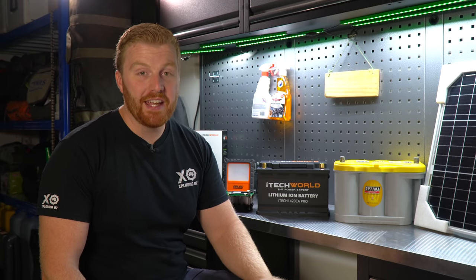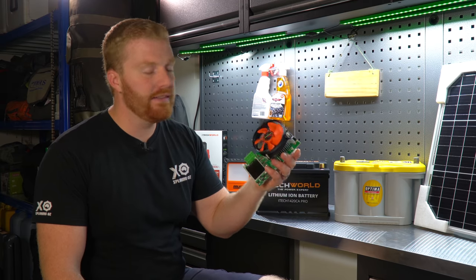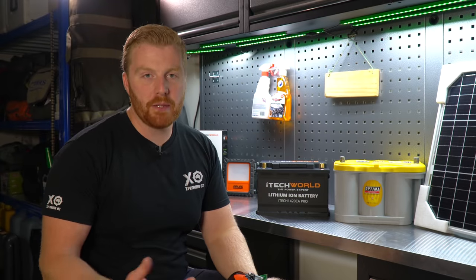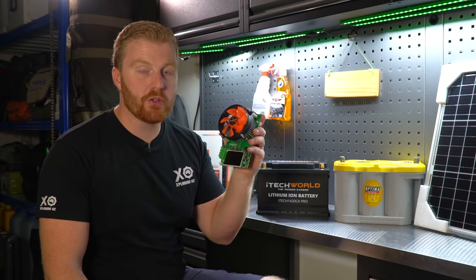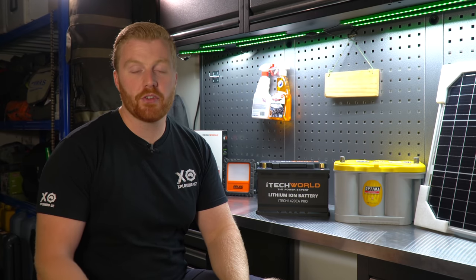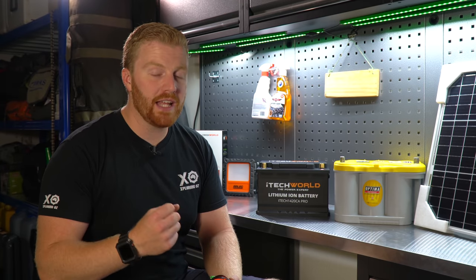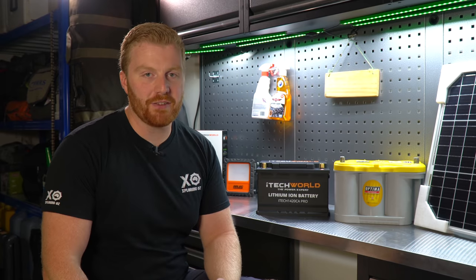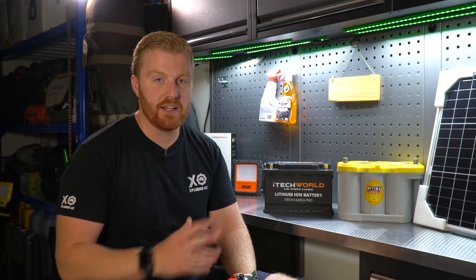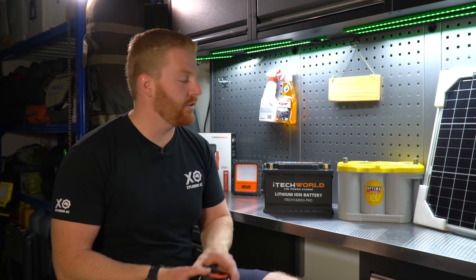First, a standard capacity test. The lithium has an advertised 60 amp hours of capacity where the Optima boasts 66 amp hours. Both batteries were charged up, let to sit, and tests run back to back with an ambient temperature in the garage of about 25 degrees. The way we measure a battery's capacity is by drawing a constant load over a period of time using a battery capacity tester. We're able to draw a constant amount of power until a minimum cutoff voltage is reached. This device can draw up to 185 watts — about 13.5 amps given our voltage levels. For today's tests, we're drawing a flat 10 amps at a constant rate and comparing total amp hours against claimed specifications. Starting with the AGM battery, we're setting a minimum cutoff voltage to end the test once it reaches that level.